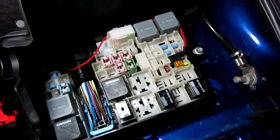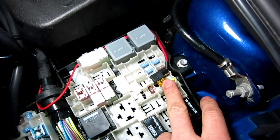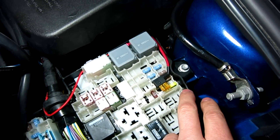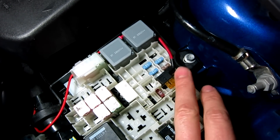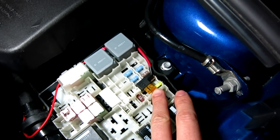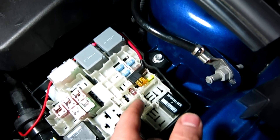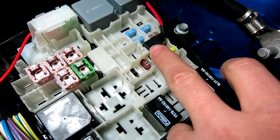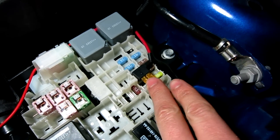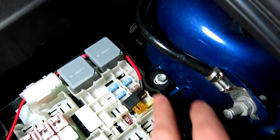There are several electrical connections that need to be made for the Guardian Angel. First, you need to power the unit from a switched 12-volt supply — there are several in the engine bay. All of these fuse locations are switched 12-volt. We found one that didn't already have a fuse in it, so we used it. This is an ST2 model Focus ST from 2014. If you need to use one that already has a fuse, make sure you put that fuse in the secondary slot of the added fuse circuit. We tested our chosen location and it works fine.